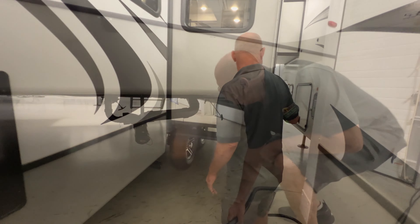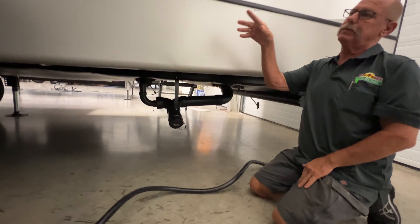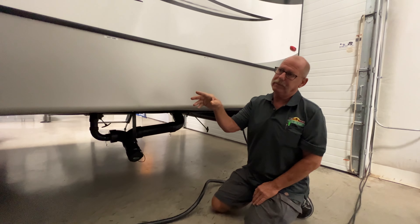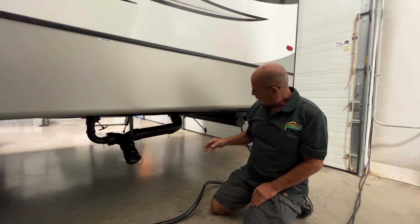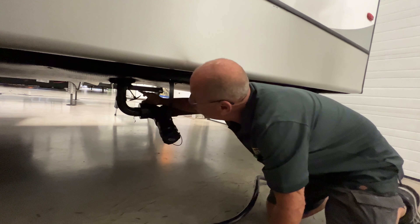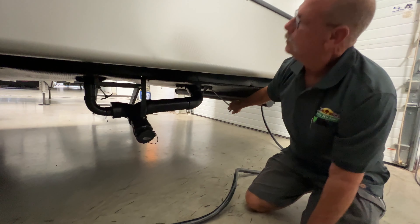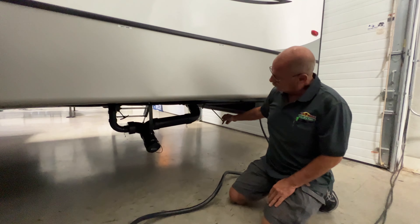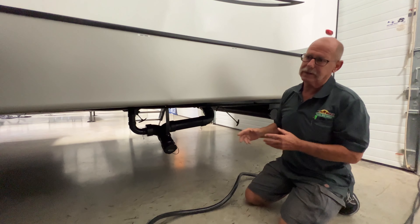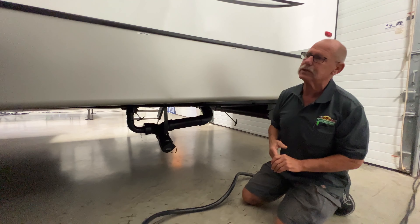When you're out walking around your camper while camping, just go through it all. Look at all these seams in here up above. Look for any little cracks down below — it's important that you seal down below, because the water will run down and seep into your floor. If you start seeing cracks in them, get your alcohol, wash it real good, take a real fine bead of silicone, put it across there, run your finger back, seal it. Same way underneath, round everything here. If you get a little bit of crack, it will allow water to come in and deteriorate your camper.